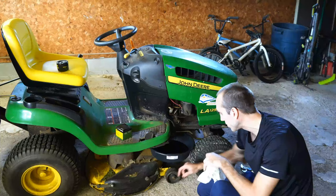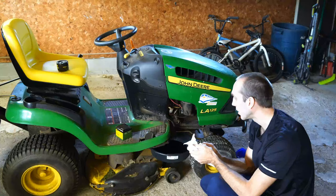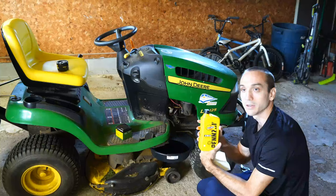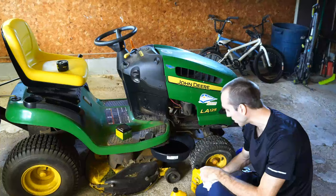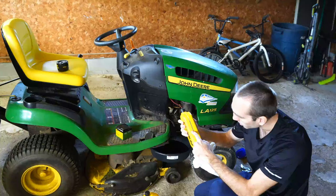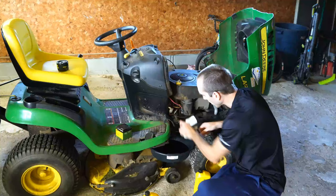I have my pan right here between the wheel and the blades, and this has been draining for about five minutes. If you're confused about what kind of oil and how much to put in, just look up the model number and John Deere on Google. For this one, it's recommended to put in 1.5 quarts — one quart plus half of another. I should have about 500 milliliters left in this bottle, and you can measure it on the side markings.